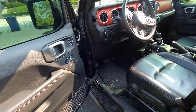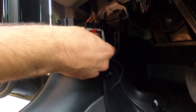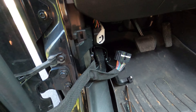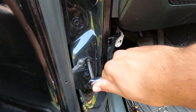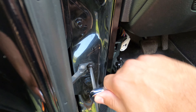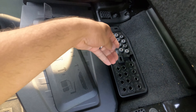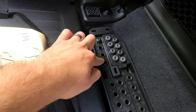Now I'm gonna start on the doors, beginning with the driver side door. The first thing you're gonna want to do is disconnect the electronics - pop this hood off, give it a wiggle, lift this white latch up, pull down like that, and now the electronics are completely disconnected for the door. Next, take this screw off using the handy Jeep tool. Make sure you keep the strap on because you don't want the door swinging open. Take the screw off, undo the strap, and the door comes right off.